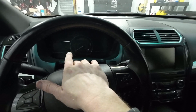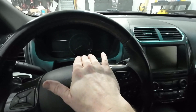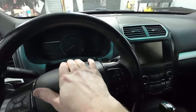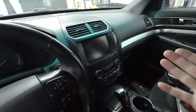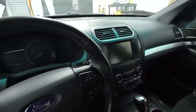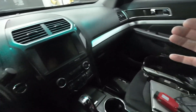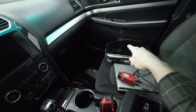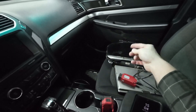The focus here is our IPC module, which is our instrument panel cluster. We're going to need that factory as-built data to flash into our new cluster. If you just plug it in as is, it will not work. Also, we care about our mileage. We cannot roll back mileage on one of these instrument clusters, but we can roll mileage forward.